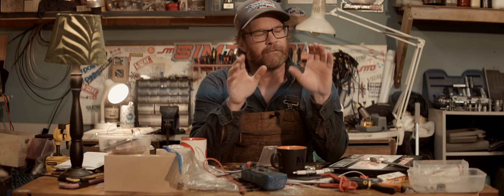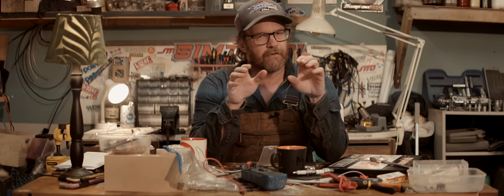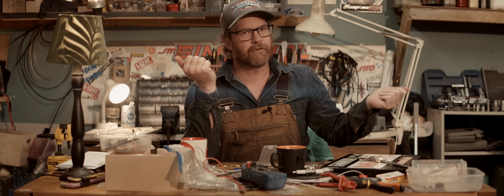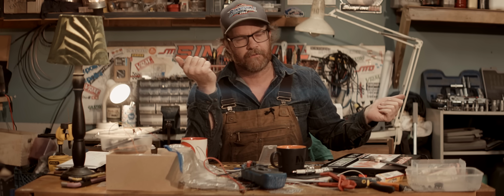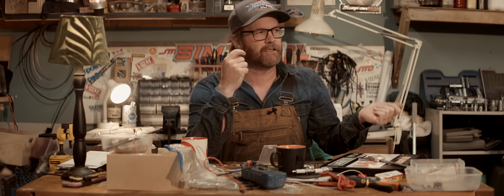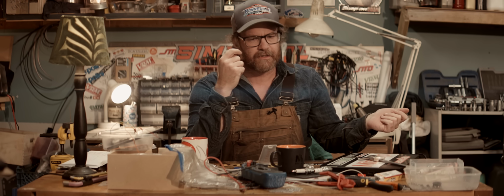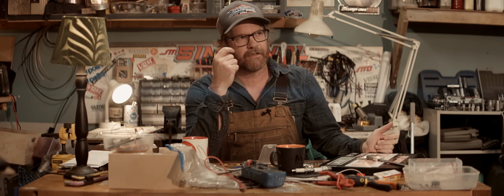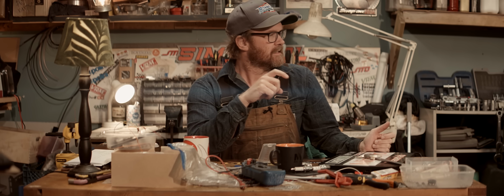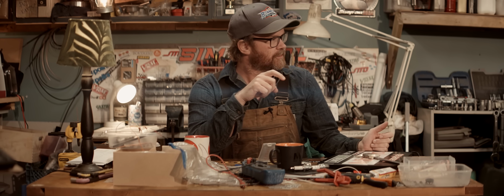Welcome back to my garage. 50cc 2-stroke on methanol and nitromethane, meant for my land speed bike. Currently we're seeing 25.3 horsepower on the dyno. That's with a 2.5mm main jet and 26 degrees of ignition advance at 16,000 RPM, which is close to peak power. Advance could be too much.